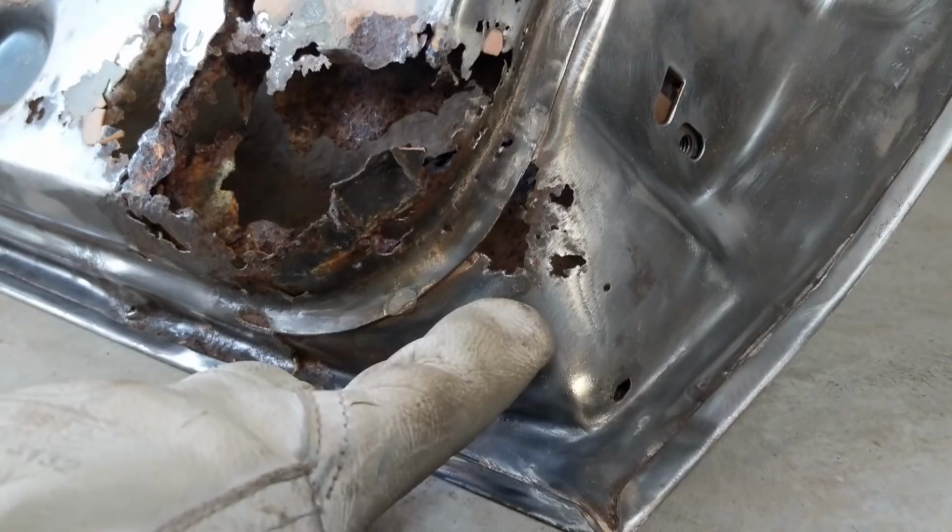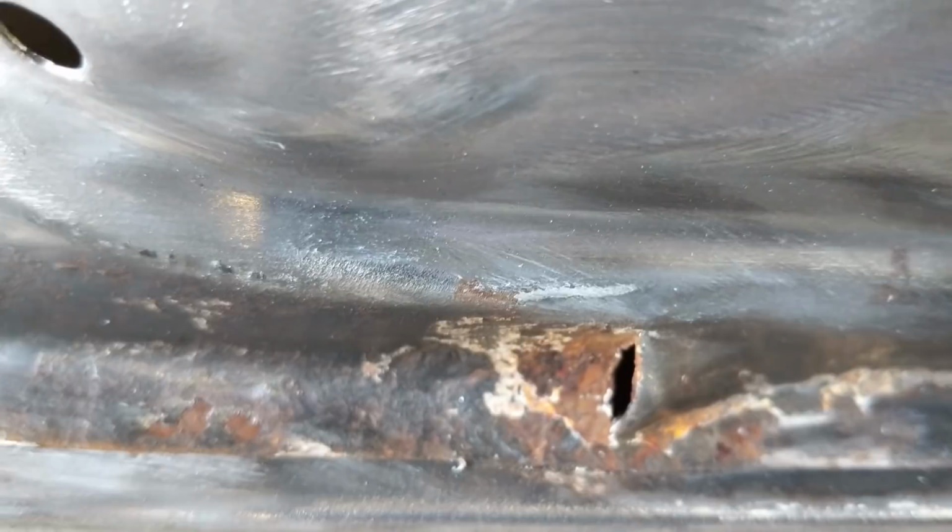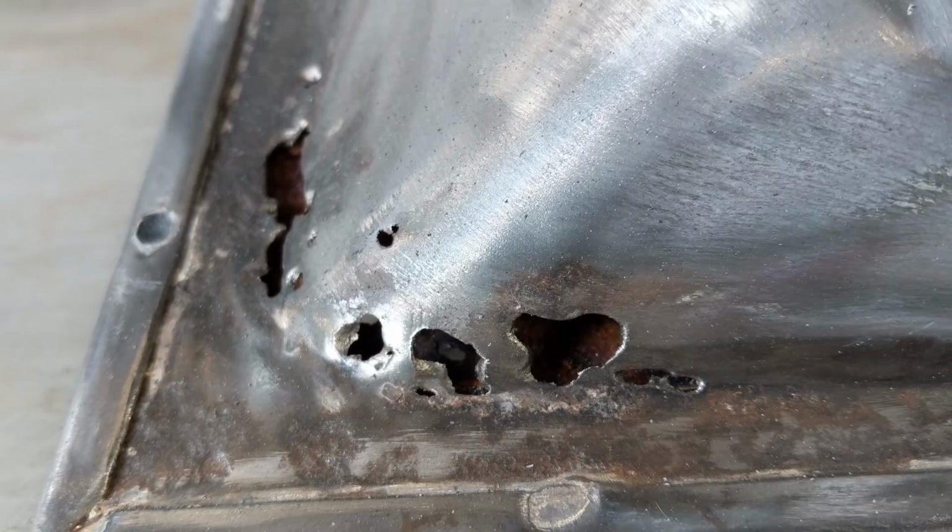When you follow along, you can see the actual drain channels that go along there. They're the culprits. They block up. You can see it's really pitted there. And here's another drain channel here. So that blocks up, and literally the water would fill it up like a fish tank. And then it can sit there for years without you knowing. And the mud and the soot sits there as well and just eats it away.